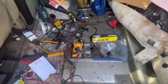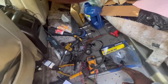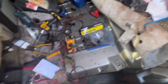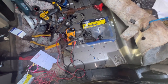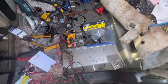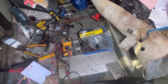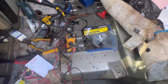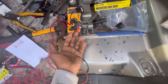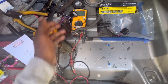I rechecked my wiring and everything was spot on — even had a Chevy guy send me the diagram, color coding and all. It was just kind of weird. The filter is not even dirty, nothing stopped up. I checked to make sure everything was free flowing. It was just a very weird process. I made sure I had 12 volts, checked my grounds, even checked the harness kit — everything is plugged in like it's supposed to be. It just doesn't make sense, but it's not rocket science. You gotta use some common sense.